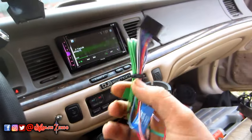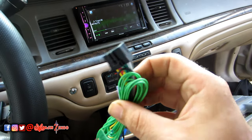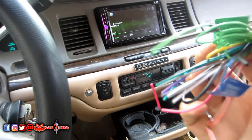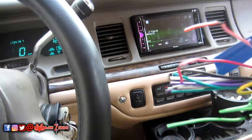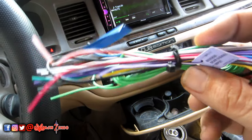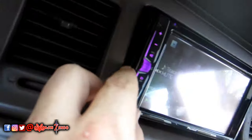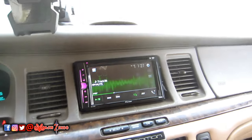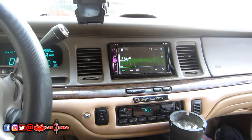Well, that was short-lived. I got excited because the harness was the same as this one, I thought — until I realized that it doesn't have the parking brake line on it that is needed to be able to play DVDs on this. So I am going to have to switch out the whole harness, which isn't a terrible thing. I need to clean up some behind the dash. I got it to where it kind of goes back, but I'm going to get it to where it can go back some more. But we are making some sort of progress, so we will persevere and push forward.